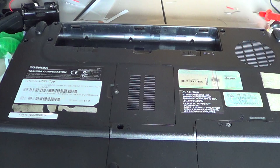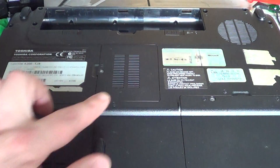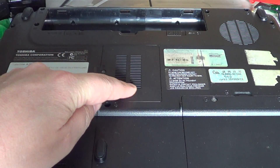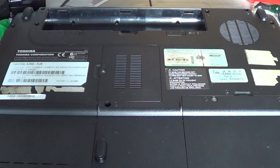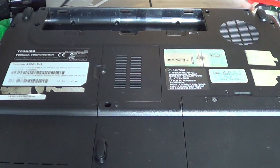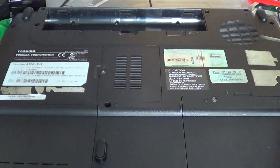All laptop computers have RAM installed at the bottom of the casing, so if you want to change RAM you will need access to the door at the bottom. Most of the time there is a small door for RAM — like on this Toshiba, the RAM is under here. Some computers like Acer have one big trap door and that's it.